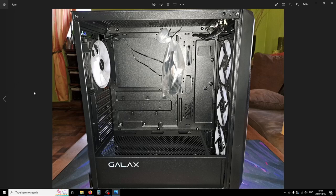This is just a swing door — you take the door off by lifting up from the top, and you can see just those hinges. The motherboard tray is very flat. There's a little accessory bag that actually had a GPU support bracket, which screws in with two thumb screws from behind. The card then rests on this, and you can set any height on the slot. There's also a nice cutout for the EPS cables and fan cables.